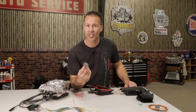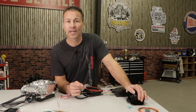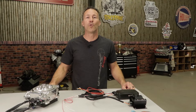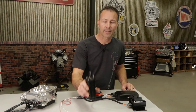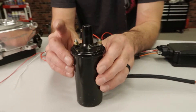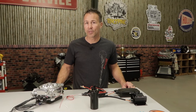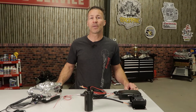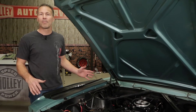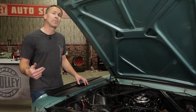The last two wires in our harness are for the ignition coil. HyperSpark will work with most aftermarket as well as stock coils, but we recommend the HyperSpark coil itself. If you're using our coil, the TFI connector will plug directly into the coil. If you want to keep your engine bay looking stock or you're using a different coil, simply cut off the TFI connector from the harness and install a pair of ring terminals. The orange wire gets connected to the positive side of the coil and the black wire will go to the negative side of the coil. To prevent radio frequency interference (RFI), these should be the only wires connected to your vehicle's coil.